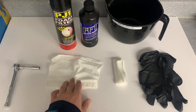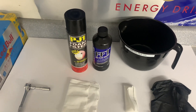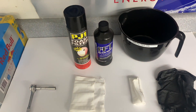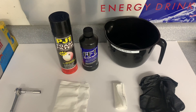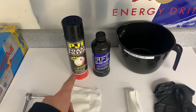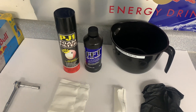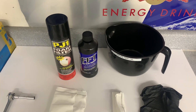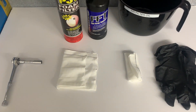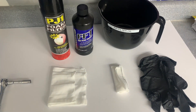So like I said, these are the filter skins from PC Racing. I've only got two of them out right here, one for each bike. I'm going to be using some gloves to keep the hands clean because it's never fun to mess around with that air filter oil. And in my case an 8mm just to get the seats off — two bolts to get the seats off. One of the filters does have some red on it, that's the old PJ1 filter foam that I used to use. Spray on, it's pretty easy to do, you can pretty much do it on the bike almost if you're willing to. But now I've moved over to the FFT by Maxima, and we'll do it in the tub, dripping a little bit at a time over each one of the filter skins getting them nice and moist as recommended by PC Racing. Then we'll go ahead and slip them on over the filters.